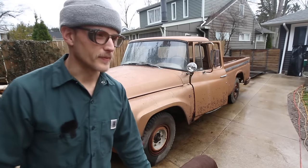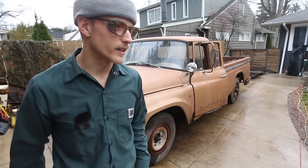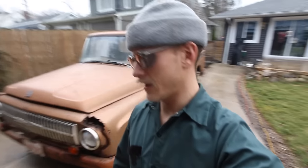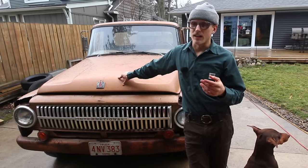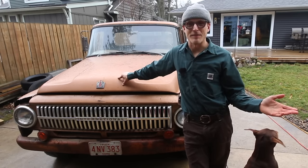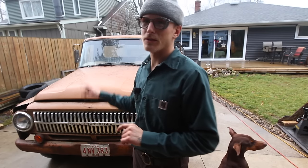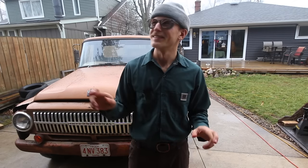All right, we got a running, driving pickup truck. I know it only went a couple of feet, but we're there. The brakes could probably stand to be bled again before I take this on the road — they feel pretty soft, there might still be some air trapped in there. Also, there is no way I'm putting this on the road without a muffler. It's loud and it's just going to draw attention to the wrong people. So in the next video, I'm just going to throw a little exhaust on this to make it quiet, and then we're going to stab it on the road — hopefully with some fun cinematography.